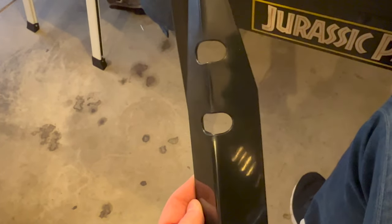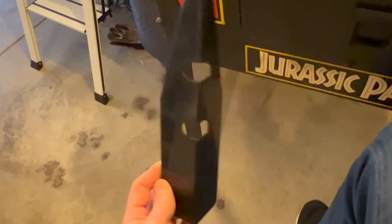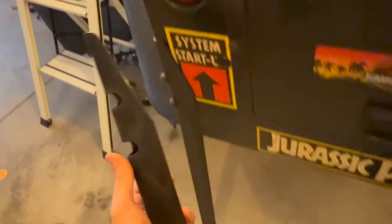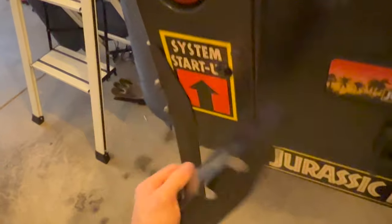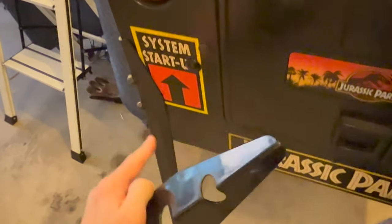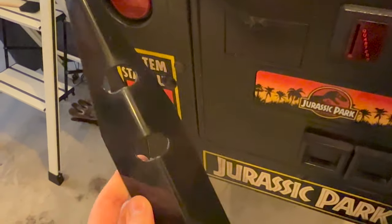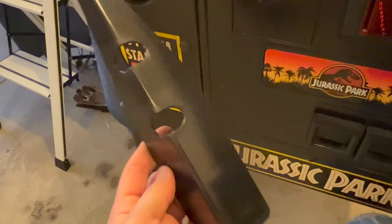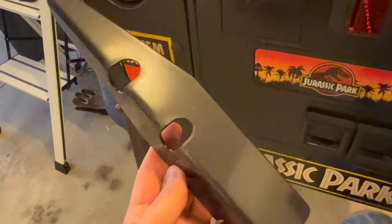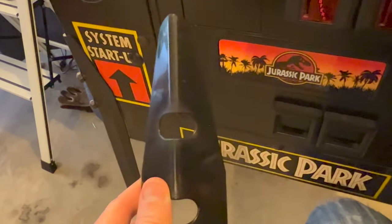And before I take the legs off and get working on scraping them up and getting them all painted, I'm gonna make sure when I put them back on, I'm gonna be using these pin guard cabinet protectors, just basic plastic body shell that goes in between the leg and the body itself. That way, when you're nudging and moving the machine around, you're not gonna ding up and scratch up and carve into the wood of the body of your machine. So these are absolutely dirt cheap. I highly recommend them. Any pinball machine you get, especially if you're worried about longevity, just pick these up. Worth it, no brainer. Cheap, easy, nice add-on.